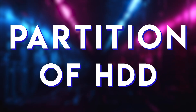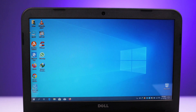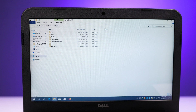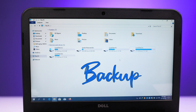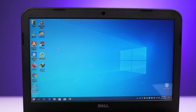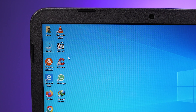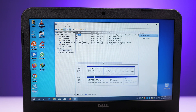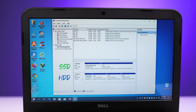There is one more thing we need to do — partition the HDD. Go to This PC, right-click on the icon and go to Manage, which opens Computer Management. Navigate to Disk Management. Here you can see two drives: Disk 0 is the SSD drive and Disk 1 is the HDD drive. Since the HDD was the previous primary drive with an OS installed on it, you will also see a system reserve partition along with the other drive letters.